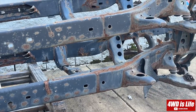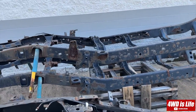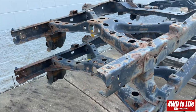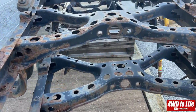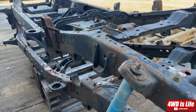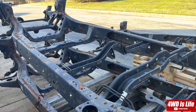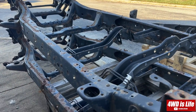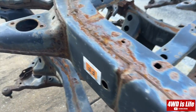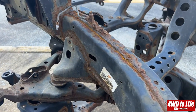Very informative — take a good look for whatever it's worth for your own need, just so you know where the rust normally comes from. That's the reason I did rust-proofing underneath my truck. I sprayed the heck out of my frame. If you live somewhere in the salt belt or in the northeast, definitely get your frame undercoated.